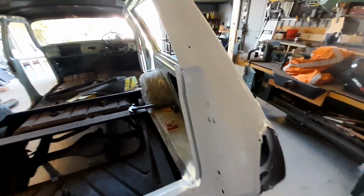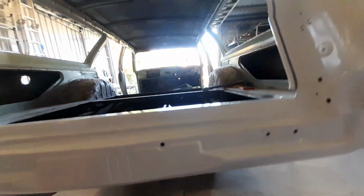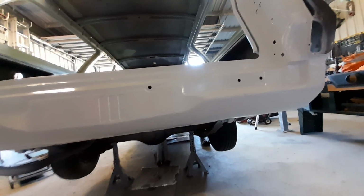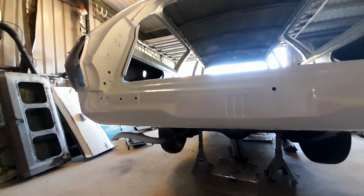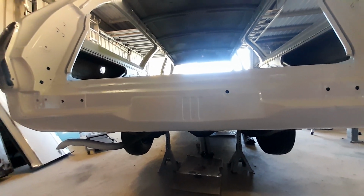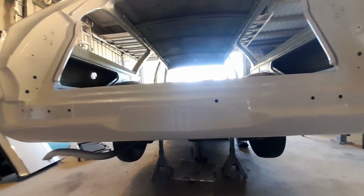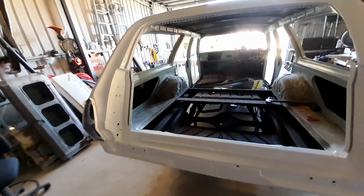The rest of it was just tidy up, bits of surface rust. I took everything on the beaver panel, I believe they call it, all along here, down to bare metal. So she's all been tidied up. I used that acid, phosphoric acid, and scouring pads and whatnot, getting all the rust out, and it took a fair old while, but it's there, and I'm happy.